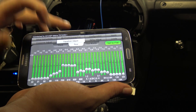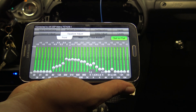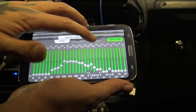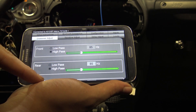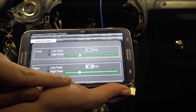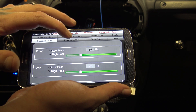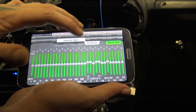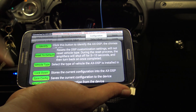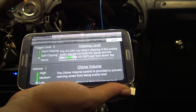The only reason I ran this is so I could go in and adjust the EQ. As you can see, that is a crazy setting — that's the rear, and that's the front. That's what I had to do to get the radio in this thing flat. You can also go in and adjust your subwoofer and set up your crossover. I'm set at 85 hertz; they had a preset at 100. You can use the little slider or tap on it, put in whatever you want, and hit send. Once you've done all your changes in your equalizer, go back to configuration, hit the lockdown button to save your settings, then save configuration and add a name. You can have multiple different configurations.